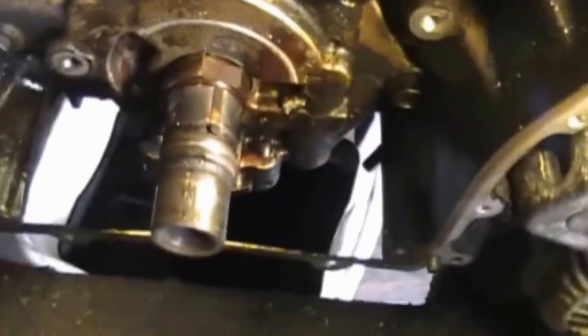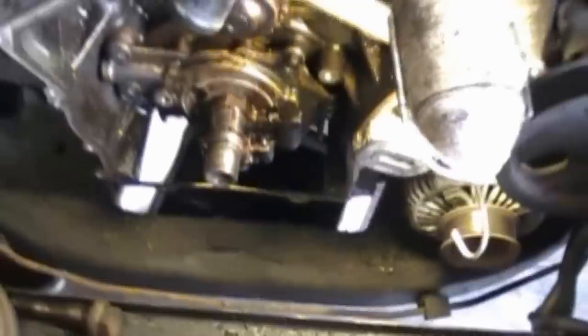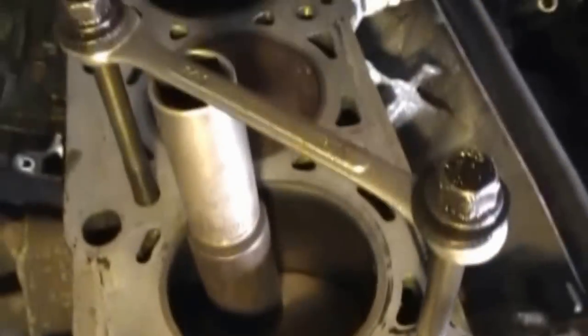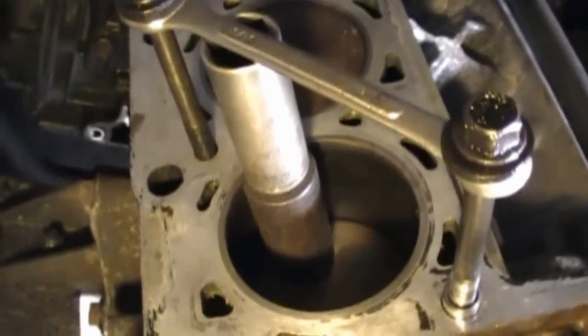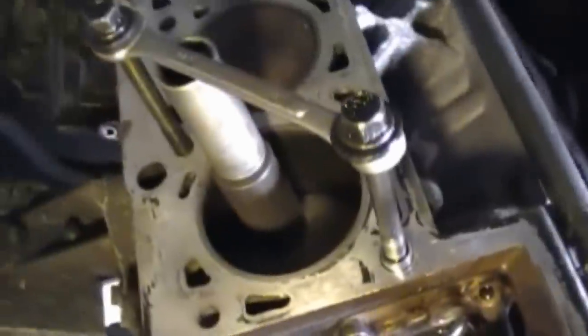One thing I want to tell you: to keep your engine from turning when you're trying to break that gear loose, take two head bolts and put a couple of sockets in the cylinders - that will keep the cylinder from moving and you'll have good grip when you're taking that bolt off. Also, to put the new gear on, I found a trick online. I'm going to stick the oil pump and water pump in first and then I'll check back in a bit.